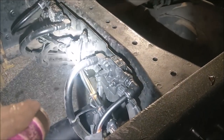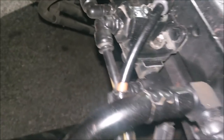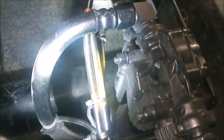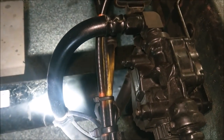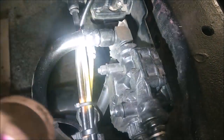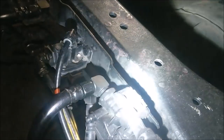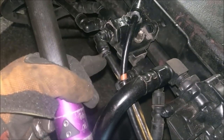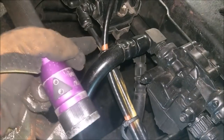I wanted to show you guys some trucks since I have different trucks here. This is a typical Paccar setup — Kenworth and Peterbilt. That center valve is the same valve that was on the Freightliner. See that line that comes up from the front of the truck? It goes into the front of the valve — that's actually a yellow line. On most of your newer trucks they're color-coded, either black or yellow. So on the Peterbilt and Kenworth models, you would disconnect that airline right there, take your fitting and piece of airline, stick it in, and that would release the brakes.